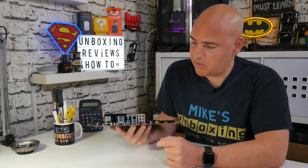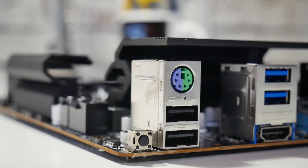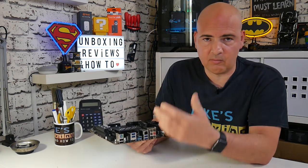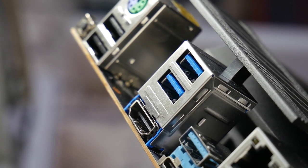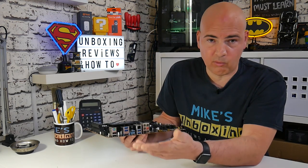Moving to the rear I/O — there's a pretty decent setup here, especially for a budget X570 board. There's a BIOS flashback button, which is absolutely brilliant: if AMD release new processors not currently supported by your BIOS, you can put the BIOS file on a USB stick, insert it into the bottom port, press and hold the button, and flash your BIOS. This also adds features like increased memory support, reliability options, and AGESA updates. There are two USB 2.0 ports and a combo PS/2 port for keyboard or mouse. There's an HDMI output, though no DVI or VGA — and it's a shame not to see a DisplayPort.